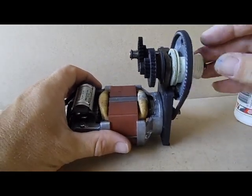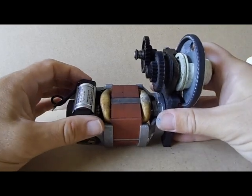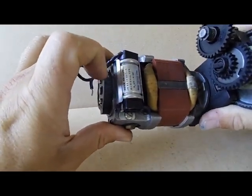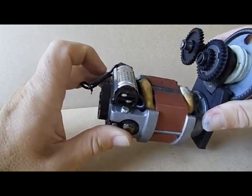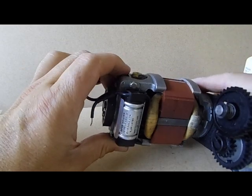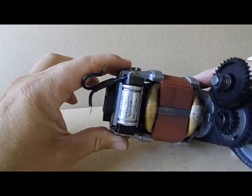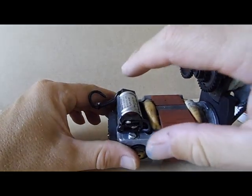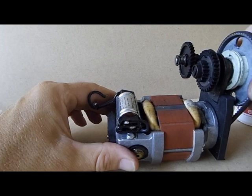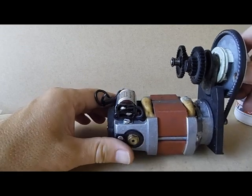That's pretty much all about that. The other thing you should maybe notice is this motor has a capacitor as well — it's also an interference capacitor that can blow sometimes, and your machine will come out with a big gust of smoke. That's a serious thing; you'd probably just have to replace it if it does blow. But that doesn't actually happen often — it's more the one in the foot control that can blow, or the actual power terminal. I hope that helps someone.